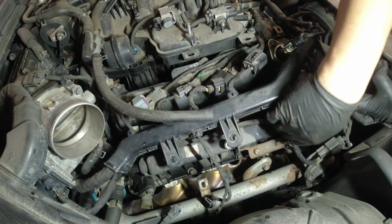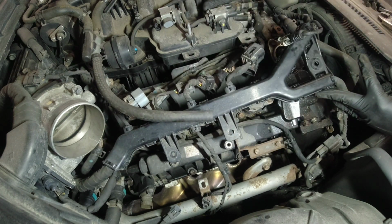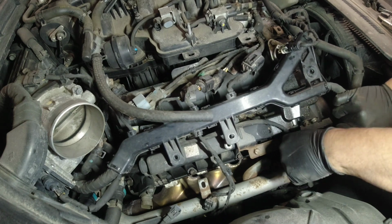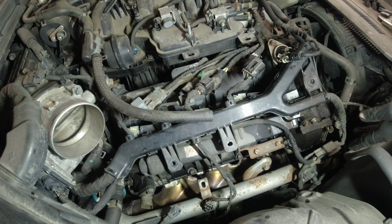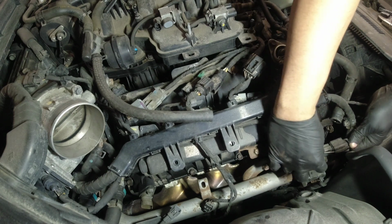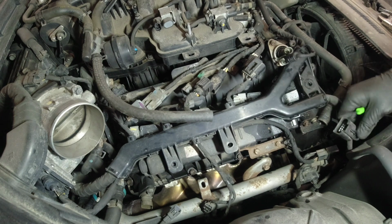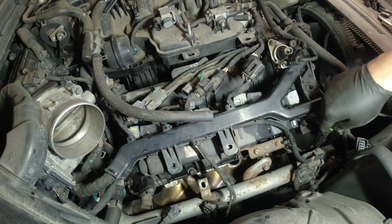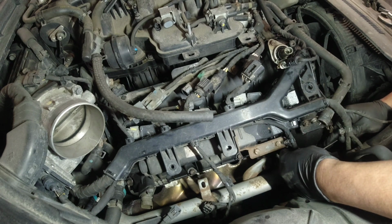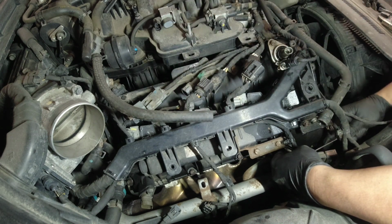There. We got this harness here for our ignition coil. We're gonna remove that, right? Yeah, because this attaches to the valve cover. I just removed that joint connector for our ignition coil. We're gonna remove this connector from the bracket. So I usually use just a pick, and then there's a hole on the bracket. I'm just gonna push it inward and then pull.